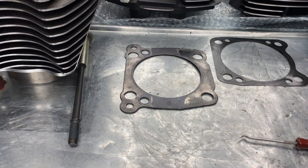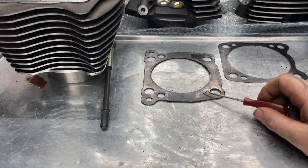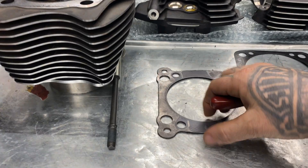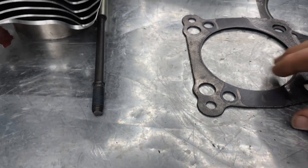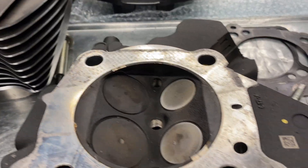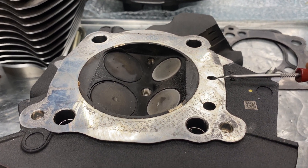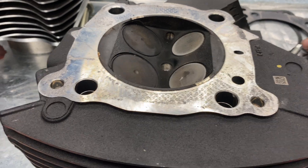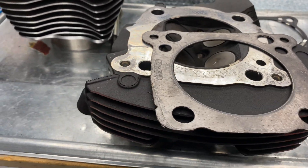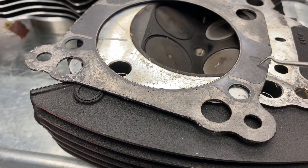An issue we have with these is with the cylinder head on the M8 — there's a generic casting for the M8s. This little hump or circular overly thing you see here, there's a reason why it's there. With Milwaukee-8, there is an oil feed hole here. That feed hole doesn't mean it's applicable to every model of M8. The casting has it, but depending on the model, the shutoff for it is actually the head gasket, which applies the pressure of that oil feed directly onto the gasket surface area.